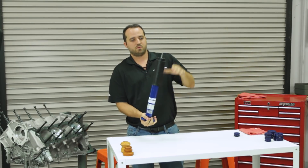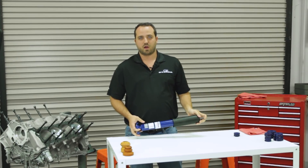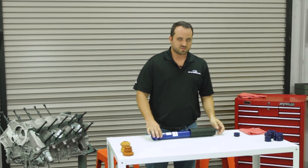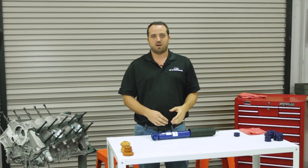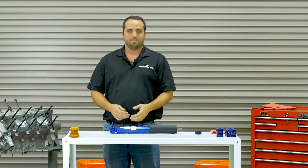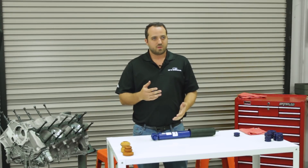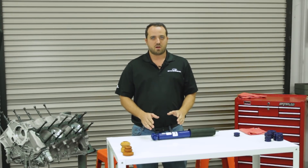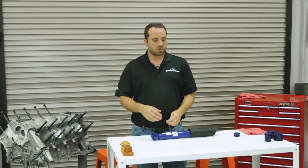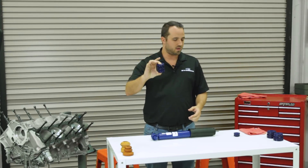All you do is put the shock back together on top, stick it in the car, and you're good to go. This is something I can't stress enough. A lot of shops — if you take it to your everyday automotive shop to put the springs on — they don't know this stuff, and it's really not their fault, they're not specialists. So just remember: if you take it there, they've got to trim the bump stops, or the better way to do it is to install the Steeda adjustable bump stop kit.